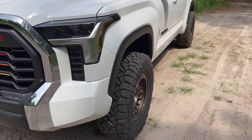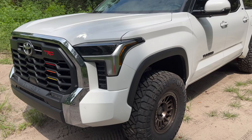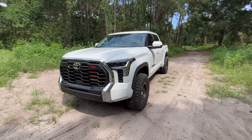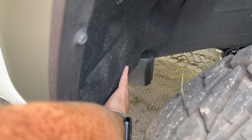The next thing to consider when lifting your truck is offset. This is a zero offset. A lot of individuals are electing to go for a more positive offset to bring the tire closer into the wheel well so it doesn't have this much poke. When you have this much poke going out, you do rub ever so slightly. After I got my truck aligned, I'm only rubbing barely on the passenger fender liner — on the driver's side I was able to cut it out and don't rub at all, but I do a little on the passenger side since I haven't cut that fender liner out yet. It barely rubs and only at full lock in reverse, and it hasn't even done damage yet.